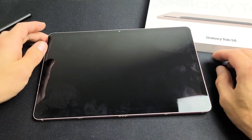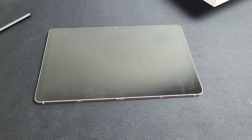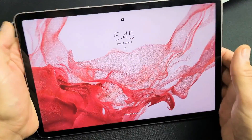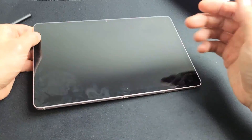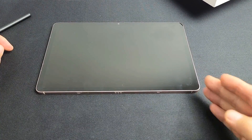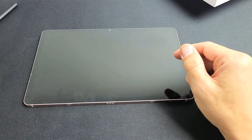If you're still stuck, the next method is what I call the freezer method — I want you to put this tablet in your freezer. Grab your tablet nice and naked, go to your freezer, put it in, and leave it there for 20 minutes. After 20 minutes, grab your freezing cold tablet and press the power button to see if you're out of the boot loop. If you're still stuck, force restart it: power button, volume down, press and hold until the Samsung logo appears. If you've tried all these steps and it's still stuck, start over from the beginning and try every step again — up to seven times, because a lot of times the seventh time is the charm.